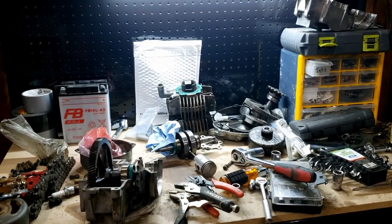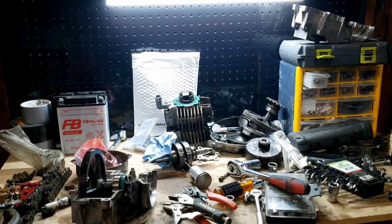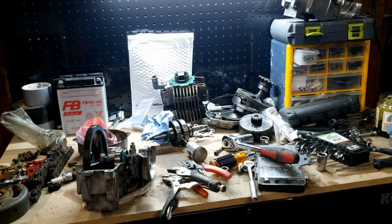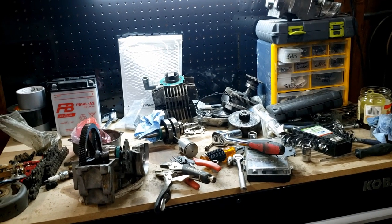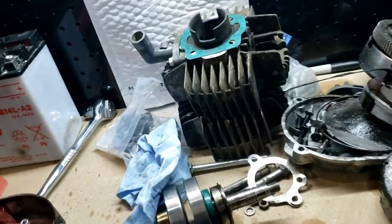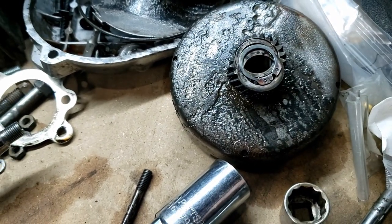This thing was bad. The main gear and the clutch bell were just caked in this thick hardened substance that you had to chip off. We spent hours going tooth by tooth in the main gear, painstakingly getting the stuff out. Whatever chemical process happened inside that engine, it put serious gouges in the main gear material and in the clutch bell. Even today, after a serious cleaning, you can see those are not gunk sitting on the outside — those are indents; this material is just eaten away.